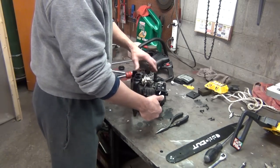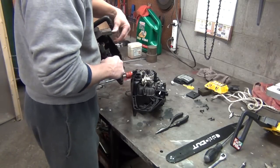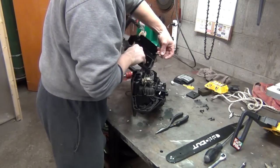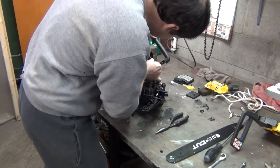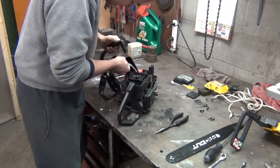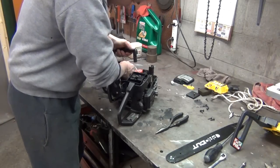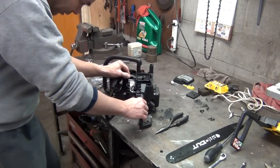Okay, now we've got that tight. So now we need to put our cover on. First thing we want to do is hook our fuel line from the tank to the primer bulb. It's kind of hard to see. I'm going to set this plug in like this. Just hook that in. And then you've got this other line coming out of the primer bulb into this side